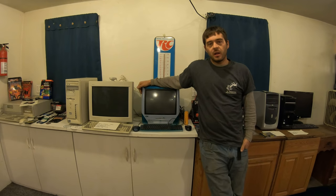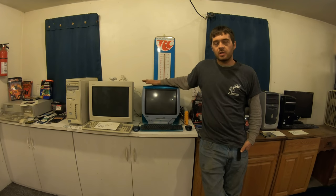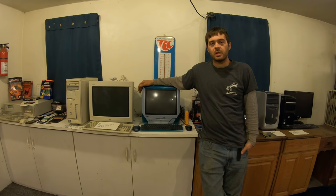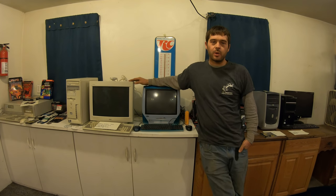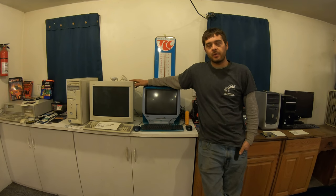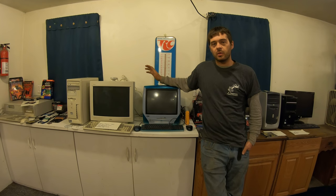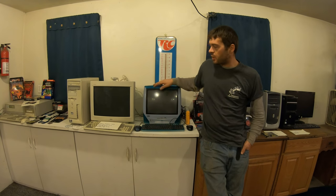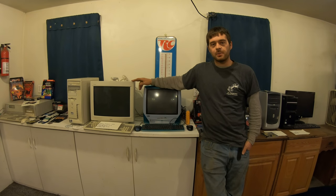That's when I was late in high school, and I started taking some trade classes on computer repair and computer networking. That was cool because that's how I really learned a lot of stuff — we were just in classrooms all the time with an endless supply of computers, doing stuff to them constantly with teachers showing us what to do. A lot of fun. Stuff I did to these computers: both of these came off Windows 98 and I loaded Windows XP on them. XP was a little too slow to run on the eMachines, especially with 64 megabytes of RAM. The Dell at 450 MHz could handle it.